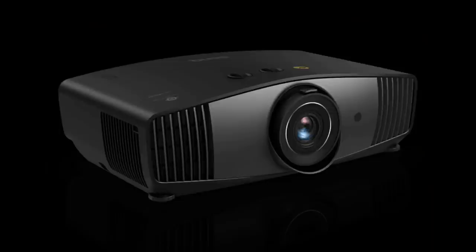It took me a couple of weeks of tinkering to really get it where I wanted it, which is not ideal. My BenQ 4K projector in the back of the room took maybe half an hour to set up. I'd highly suggest going with a floor-rising screen. If you have a ceiling drop-down or fixed screen, your only option — since this projector has no lens shift — is to physically move the projector, build a stand, or mess with the keystone. That can be really tricky. I'd be very careful with a fixed or ceiling drop-down screen.